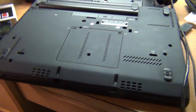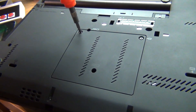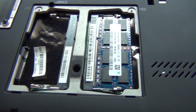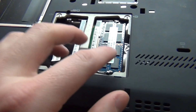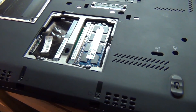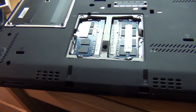The first thing is pretty simple. We're just going to take off these two screws so we can remove the bottom cover to get access to the RAM. Just unscrew these two and then open the bottom cover up. Pleasant surprise here — we actually already have a four gigabyte stick installed. I was under the impression we'd have two two gigabyte sticks, but I was wrong. That means I have an extra four gigabyte stick we can use in another laptop. Now we have two four gigabyte sticks installed for a total of eight gigabytes.